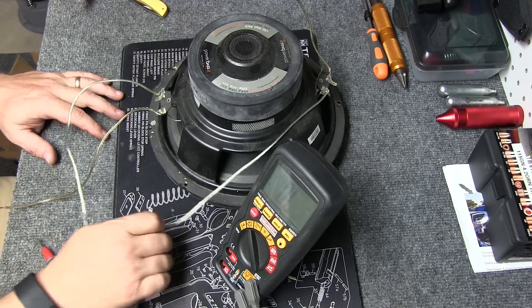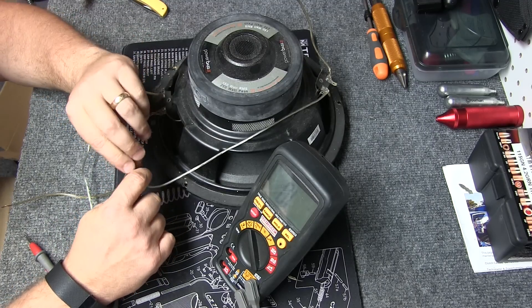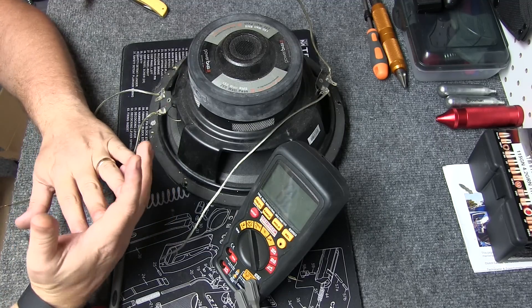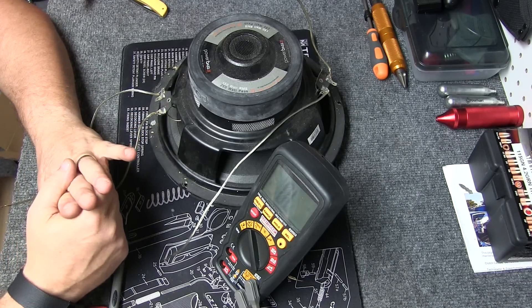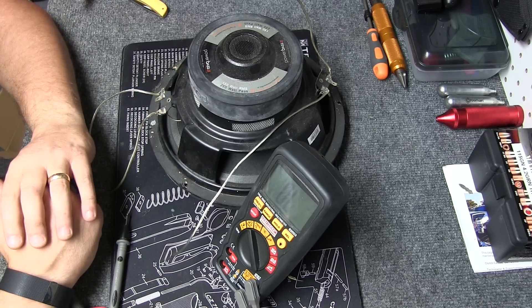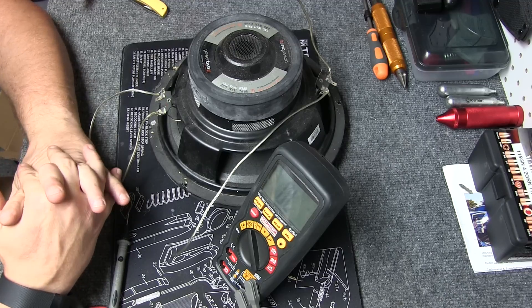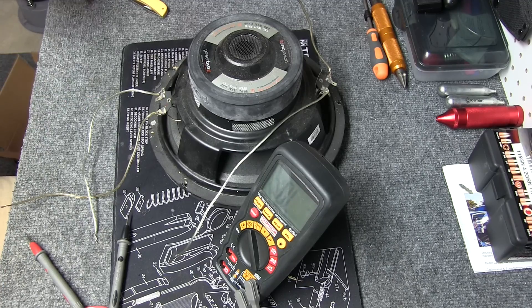That's it — just a quick little thing. If you've got a set of subwoofers that don't have the rating on them, or you can't find it anywhere — which these days with the internet you could typically find them — but if you can't for some reason, this is an awesome way to check it. That way you know for sure you're not going to overpower your amplifier, because it runs hot, all kinds of things. And you don't want to go below the rating — I've done it in the past, I've run amps down to half ohm before, and I eventually do smoke them. I got pretty lucky with them, but that's it — just a quick video on how to read ohms and how to connect your speakers. Hopefully that all makes sense. If you do have any questions or comments, be sure to post those below. Please subscribe, and thanks for watching.